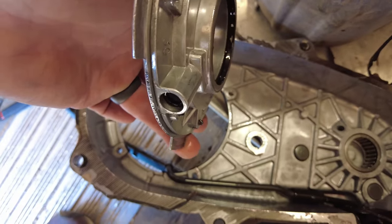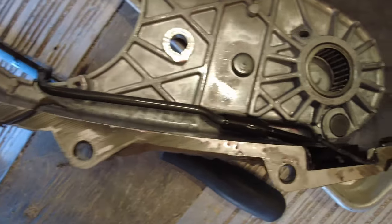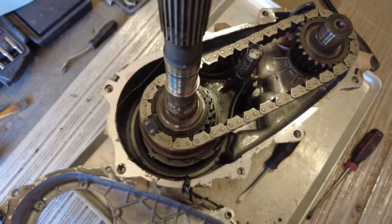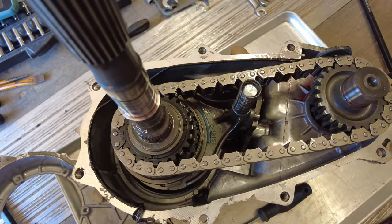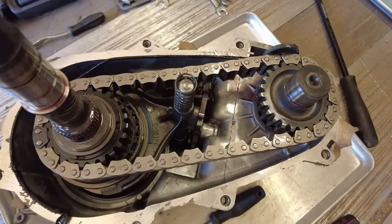Once I have the two case halves cracked apart, I took the O-ring off of the fluid tube and stuck it back in there just to make it easier. I would suggest cleaning the filter and the magnet in the bottom of it to get any particles out and keep your transfer case as clean as possible. The second you pull the case halves apart, take a picture of it just to see how everything goes — so when you reassemble it and if you forget, it'll make life a lot easier than trying to guess.